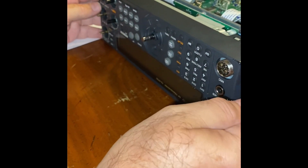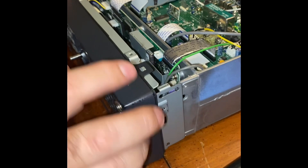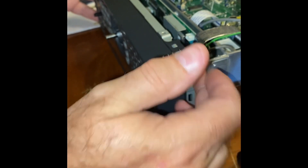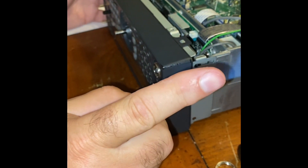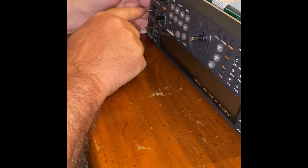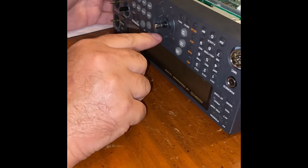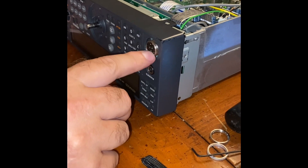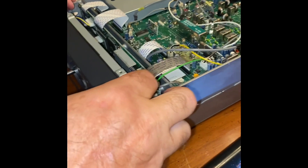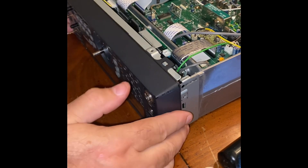What you're wanting to do is get this black metal piece — which has some clips on the top and the bottom — removed from the inner metal piece. Be easy with these clips. The steps are: two screws here, two screws here, three screws here, three here. Remove this ring and the screw here. Remove the two rings here. Once you've done all that, you can take these clips, raise them on top and bottom, and separate the two pieces.